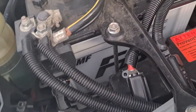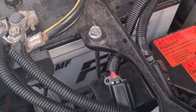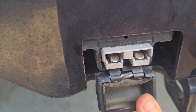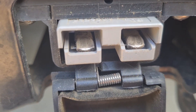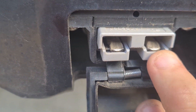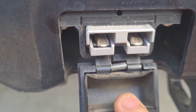There shouldn't be any joins from that point all the way to the Anderson plug on the rear of the car - unless whoever did it has used off-cuts. So let's go down to the Anderson plug. Back to the garden hose analogy - we can get a blockage at any joins and fuses. As you can see, the two pins inside the Anderson plug sit nice and proud. Check to make sure that one of these pins hasn't dislodged and pushed back, because then you're going to get a bad joint and no flow.